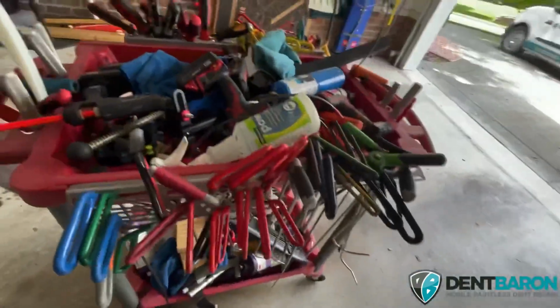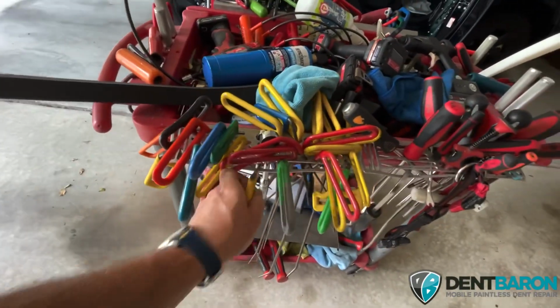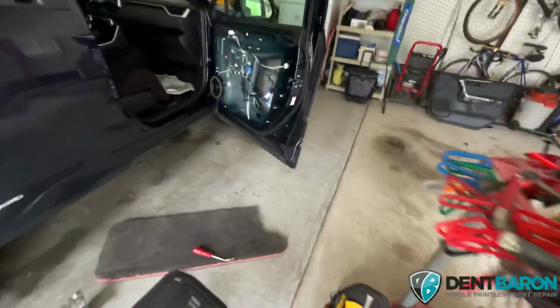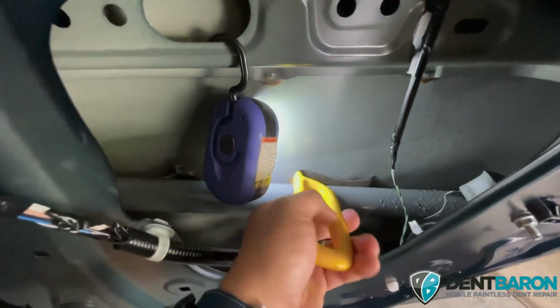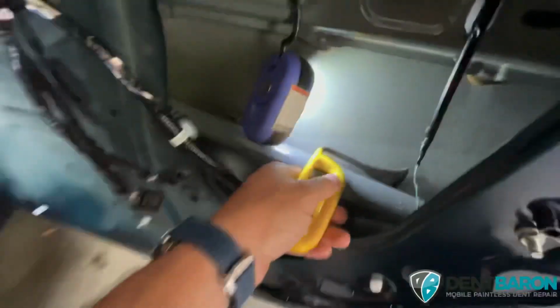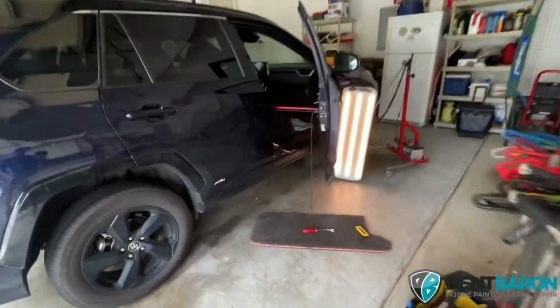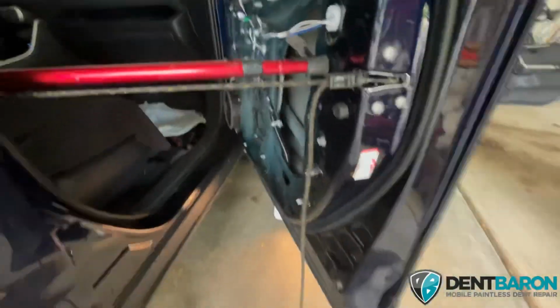So weld tab. And which one we're going to use, well, let's find it. Here it is. Extra wide, the narrow grip with this hump. And why are we choosing this one? Simple. Because I can do a twist here easily and nothing's in the way while I'm working the dent. That's what we're going to do. So as you can see here, we're using a hood prop rod and a ratchet strap. That way, we have easy access here, and you can see the dent.